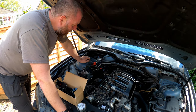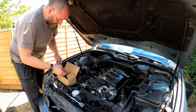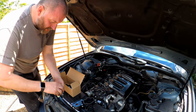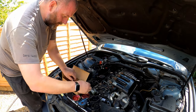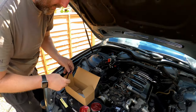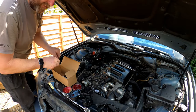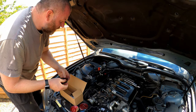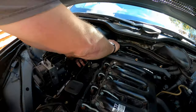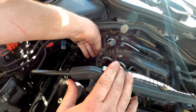In the package, we'll take the actual valve out itself. Here are the two new gaskets. What I like to do with these kind of gaskets is just give them a little bit of red rubber grease all over. This just keeps them nice and supple, and if they're nice and supple they don't crack, and if they don't crack they don't leak. It helps prolong the life of them. If you look at these old ones, they're all pretty minging and they feel quite brittle — that's what this helps us avoid. So that's them nicely greased, and then we can fit them back in where they go and just tuck it all the way around back into the groove.